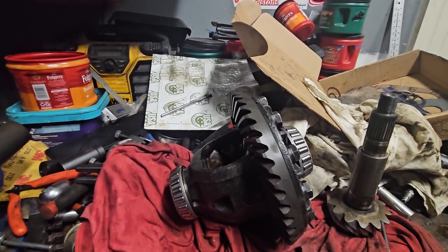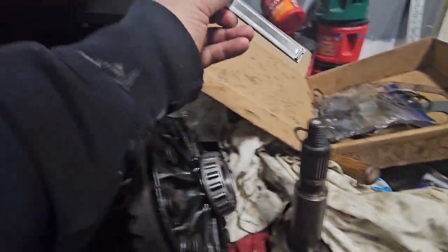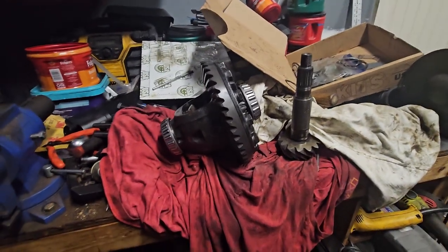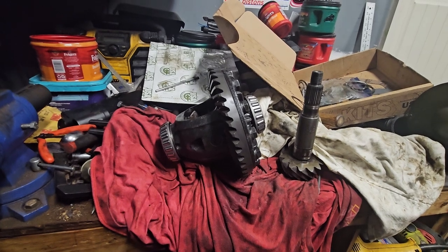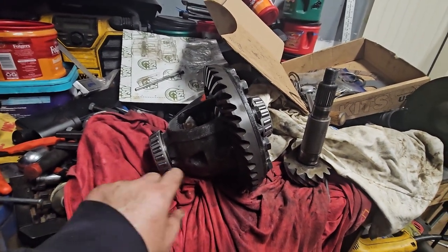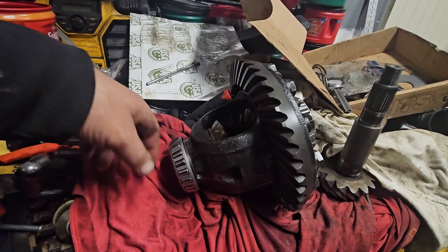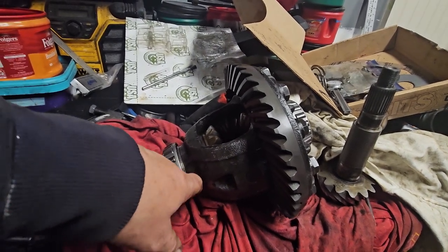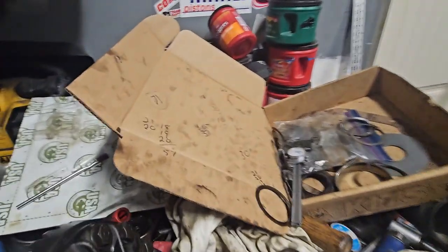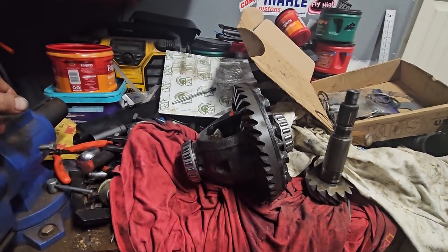It was tight before, but now I was, where's the micrometer? I was 10 thousandths off, which, I mean, isn't a huge amount, but it is a huge amount when we're talking about this. So I was trying to get lucky, and I was taking this side off because this side is really hard to get off and still save the bearing. So I was tapping on this side, and of course every time I was chiseling this off, I was ruining these shims. And so I started using what I had left over and started bringing the math down each time, writing down what I had. I did it three times, I think, maybe four, and now it fits in great and it rotates great,